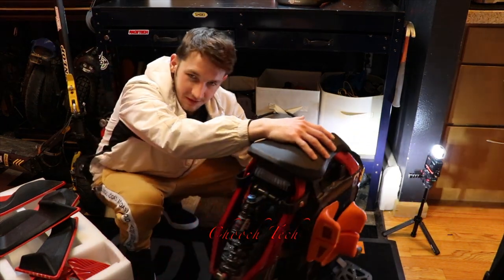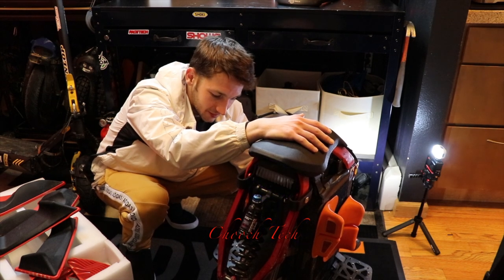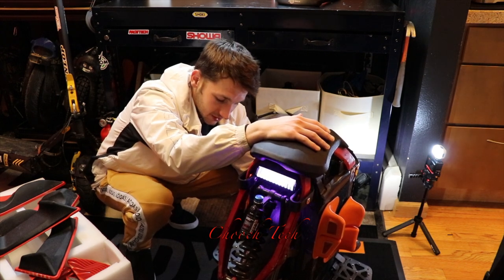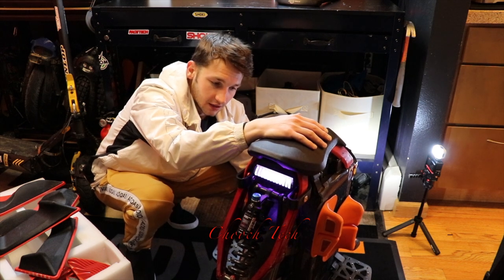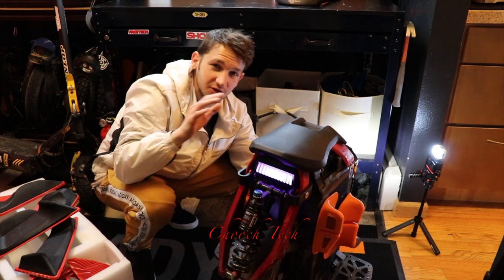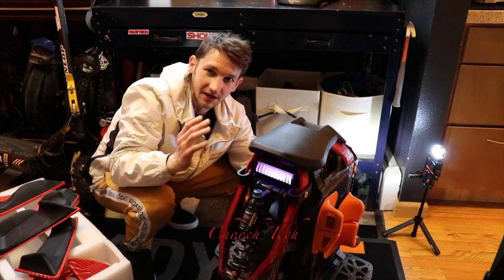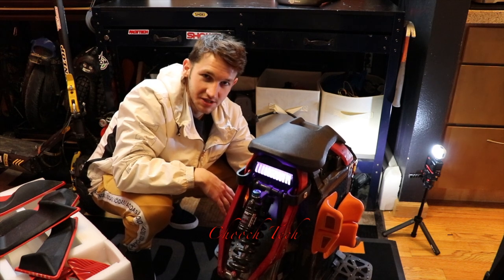And I never really thought about that before I got this wheel or rode a wheel with pedals where you could adjust them like this. But I see exactly what they're good for and what they're not good for. Having them in the back position like this, if you're trying to do trail riding where there's steep inclines, where it's just corner after corner, where you're just going with not a lot of speed, and you're trying to turn at a switchback or something, and then go up it, having the pedals back like this is terrible because you just have no torque there.